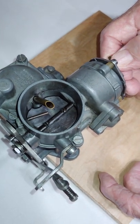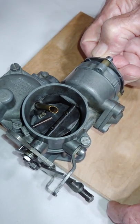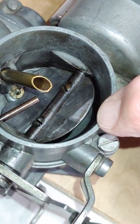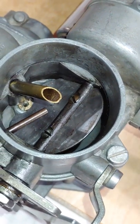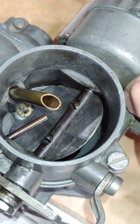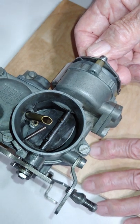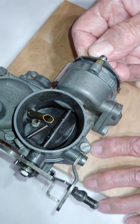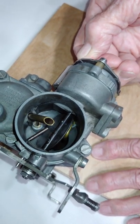I like to set the choke plate about a quarter to three-eighths inches from the throat edge of the carburetor — we're looking at this point right here. Once I get it set, I'm going to hold this and then tighten the three screws, but we're not through yet. If I turn the choke heater element counterclockwise, it closes; if I turn it clockwise, it opens.